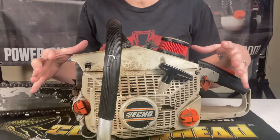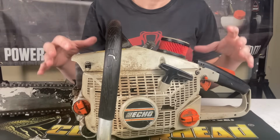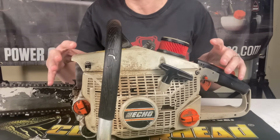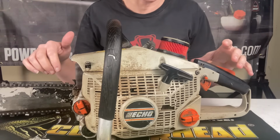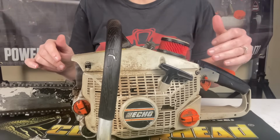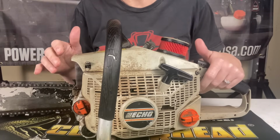This is a 27-year-old chainsaw. It is an Echo CS5000 made by Kioritz, and it is just super powerful, 50 cc's of power in this small, compact body, super light, came with a 20-inch bar with 325 pitch chain on it. I'm just telling you, these were some of the best saws ever made. On top of that, it has an HDA Walbro carburetor on it, which was one of the best carburetors ever used on these small engine two cycles.